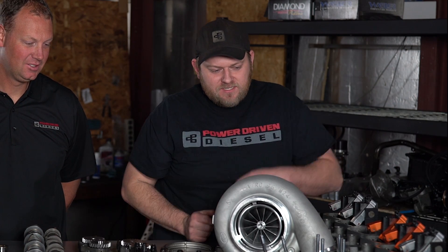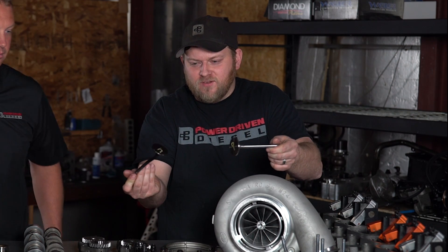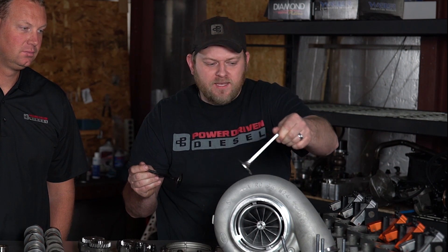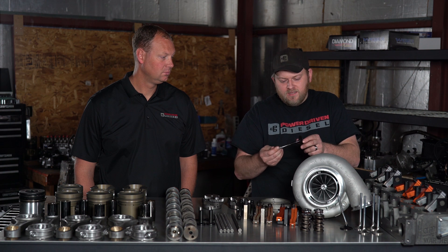Along with the rocker pedestals, we've got big valves going on this Warhead. Here you can see bent valves from the cam failure — valves can bend. These new ones are Inconel, not stainless steel. Inconel is a lot better with heat — stainless steel starts bending and tuliping at around 1,600 degrees, and we plan to go well over 1,600 degrees in this engine, so you really need Inconel valves. A factory 12-valve Cummins actually has an Inconel exhaust valve — even for factory applications they don't think stainless is up to the task on the exhaust. So both intake and exhaust valves here are Inconel.